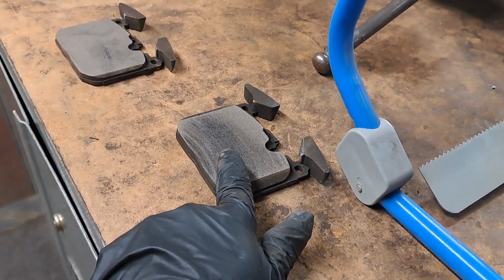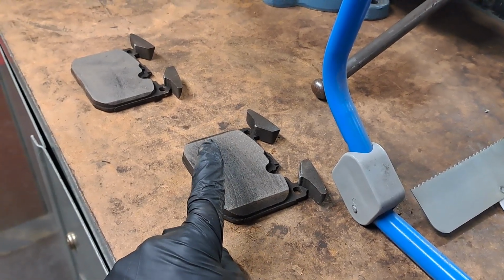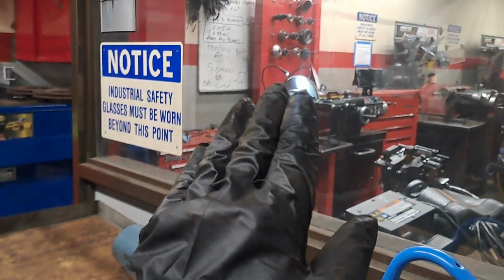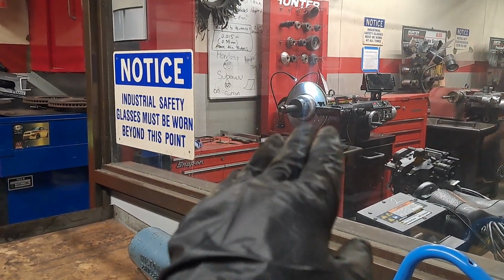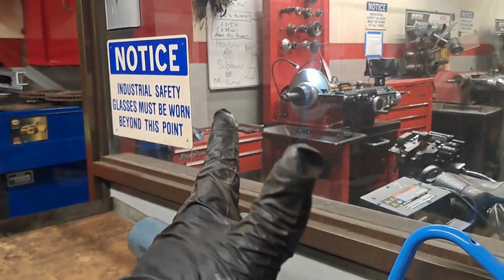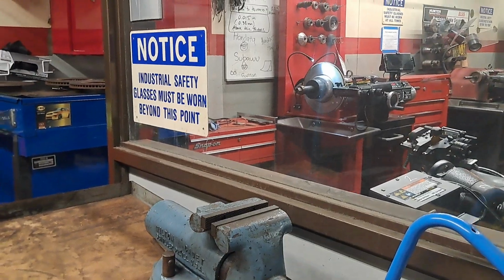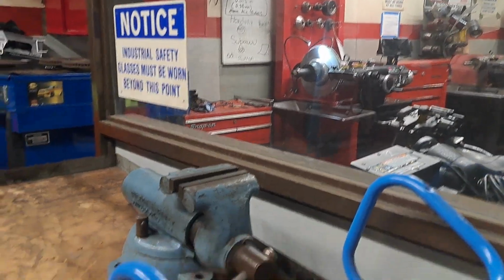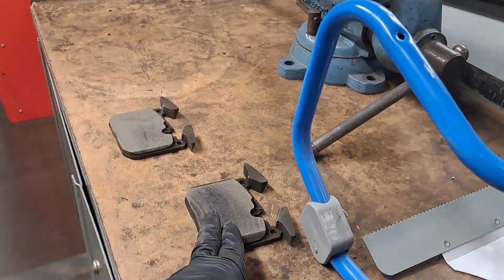And P.S., the reason this happened was mainly because it was pad slapped. So over the course of the life of a set of brake pads, that rotor is probably going to get some defects. So by the time you're ready for some new pads, you're probably ready to address some problems in that rotor. But this customer, it's a BMW, so it's typical.